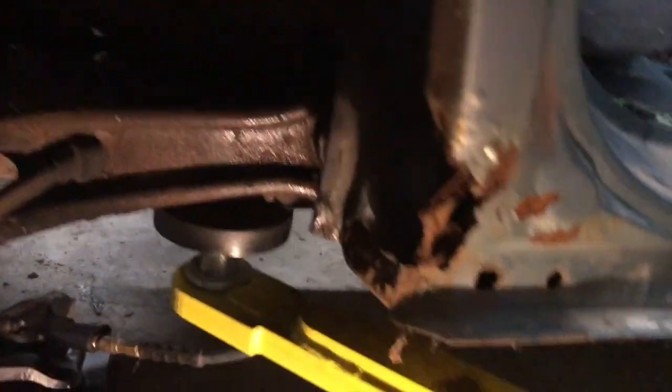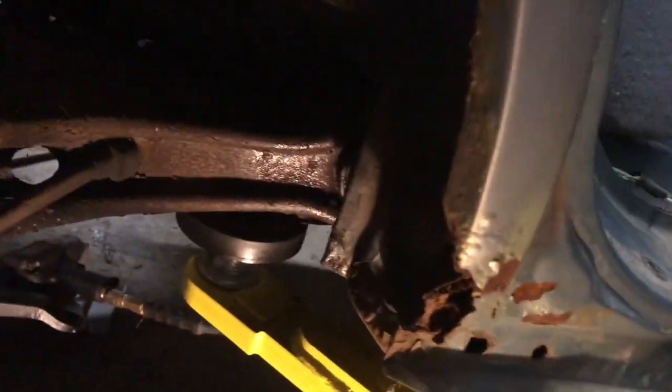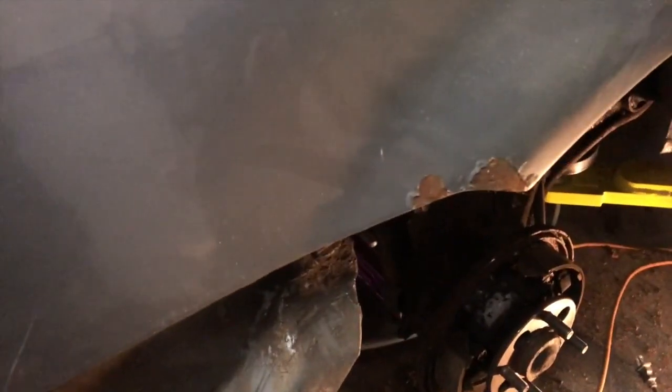So today is bodywork day. You see there's a little bit of rust here which isn't a hole yet, but if you scroll down you'll see there's a hole there. So I'm most likely just gonna cut up here and change that bottom piece. But before I decide that's what I want to do, I'm gonna grind that out to see how solid it is.